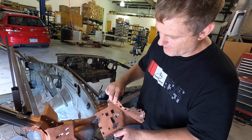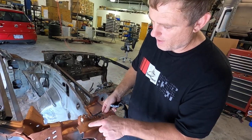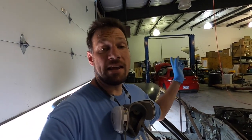I'm going to cut a little bit above the line as a safety measure, because it's always easier to remove metal than to add metal if you've cut too much away. We'll leave a little there, cut it, make it fit, and grind off a little more if needed. Then we're going to reprime the areas we ground, and once it's primed and trimmed we're ready to weld it on — more welding. So we're going to go ahead and take care of that off camera, get it all primed and set up. Catch you guys in a second.